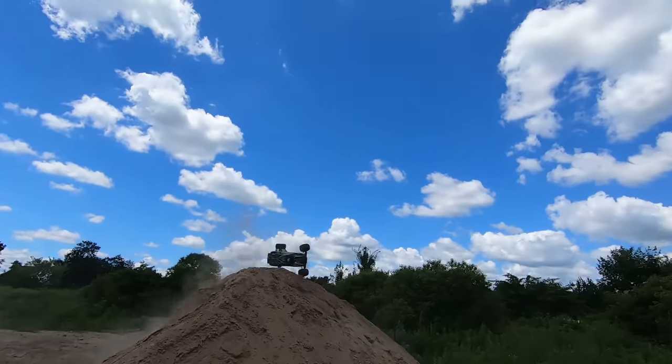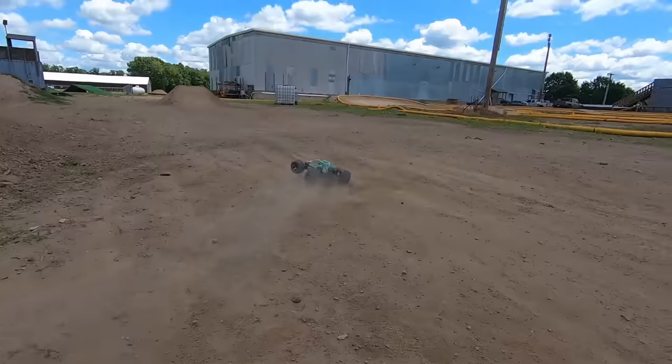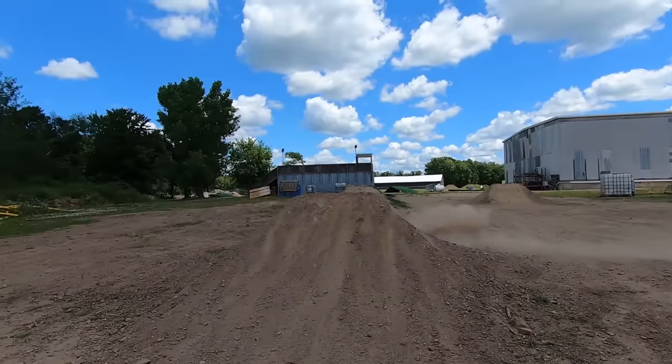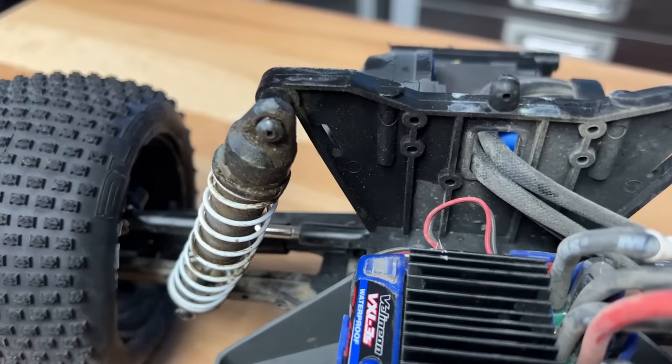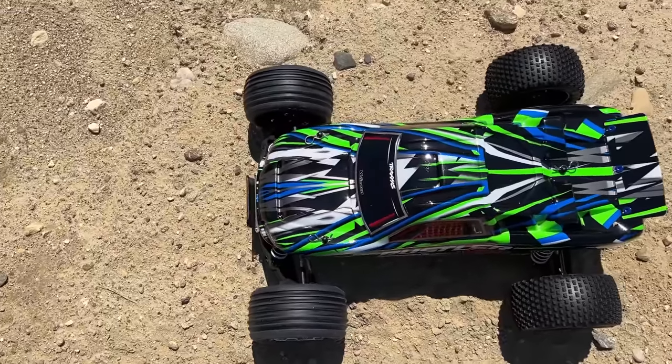This is just a fun off-road machine, so I'm just going to pull those limiters back out of the shocks and have much more fun with it in the dirt — that's where I think a lot of people are going to enjoy it. One problem I did encounter: I bent a rear shock shaft and the rear shock caps are leaking, so if you're going to do big air jumps you're probably going to want a shock upgrade. But I think this truck is going to be around for a long time because it's just a truck that works — it's fast, it's fun, and there are a ton of hop-up parts already available so you can build it up however you want.